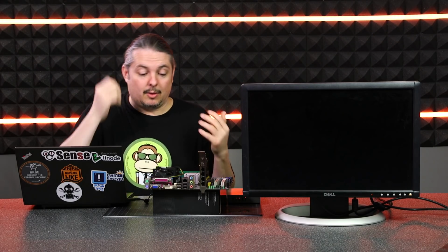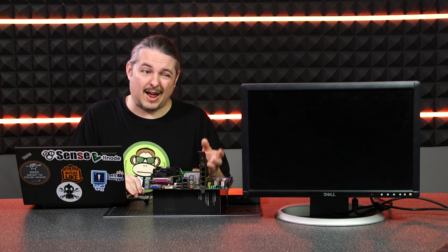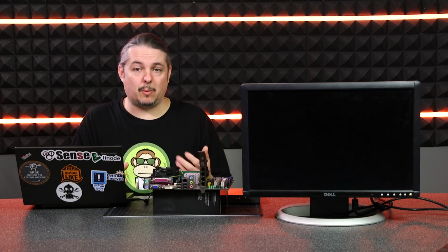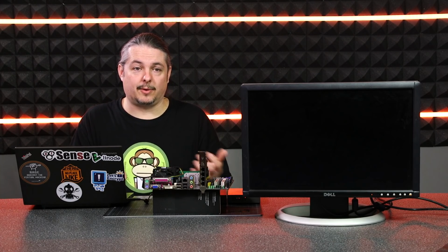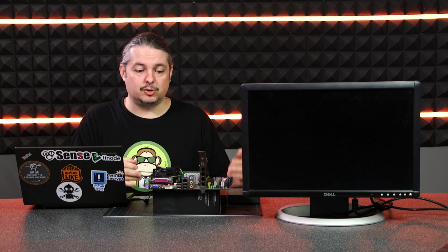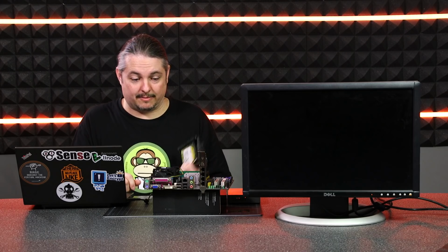They're fast. Now, a lot of people ask, do I need an SSD for pfSense as well? Not really. I mean, they're somewhat expensive. You may as well buy one if you're building one, but do you need a big one? Well, how much do you plan on saving on here for logging information and things like that? If you look at the genuine Netgate hardware, you'll see they frequently don't ship with large hard drives. And the reason why is unless you plan to dump all kinds of logging data to the drive itself, you don't really need a big hard drive.